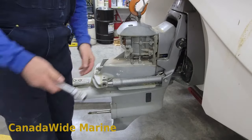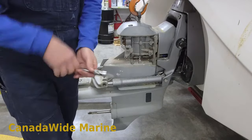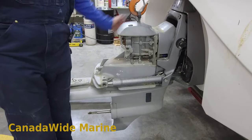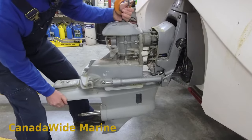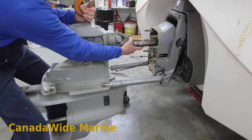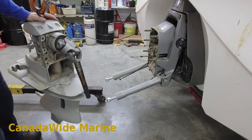Okay, six bolts out. I used a universal joint socket but you can just use a wrench - whichever you have handy. With those six nuts off, the drive just slides right out of there. Be careful to grab your drive shaft as it's coming out so it doesn't drop down and do any damage.